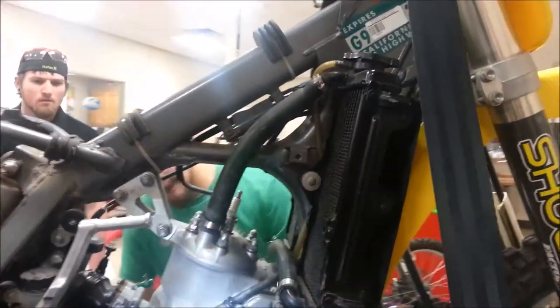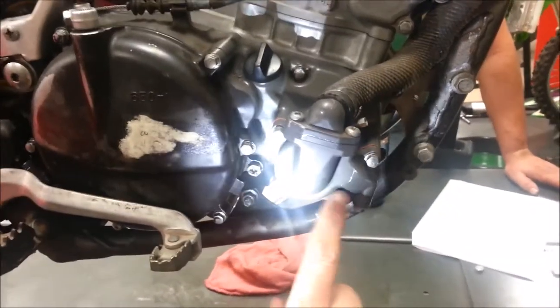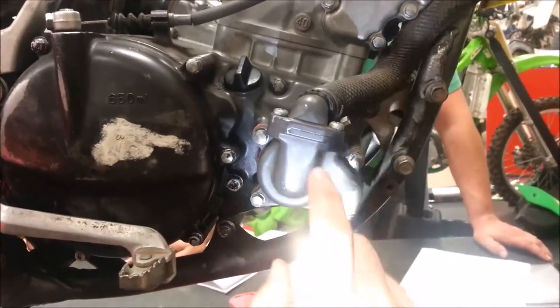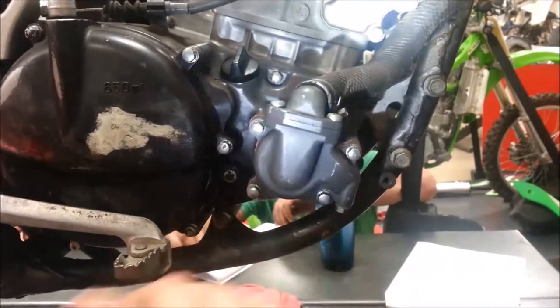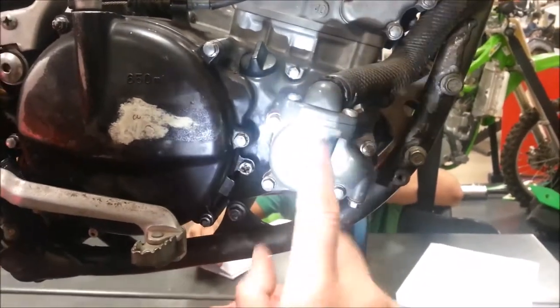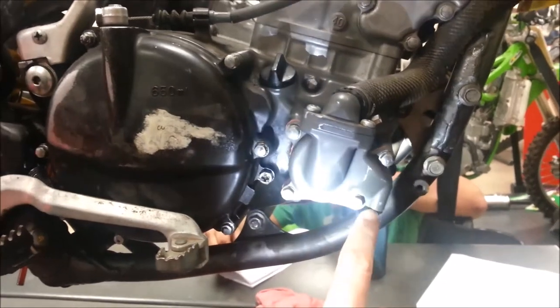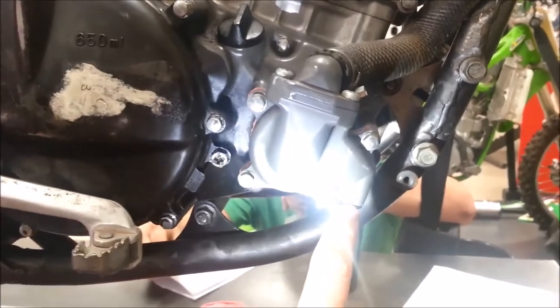So we want to go to the lowest point. As we look along the radiators here, the bottom of this goes to the water pump itself. When I look at the fasteners on this one, the very bottom one — how do you know that's the drain? We've got a whole bunch of two-strokes that have the drain sideways. Here's your clue: any time it's a drain screw, it has a crush washer, and it's made out of aluminum or copper.